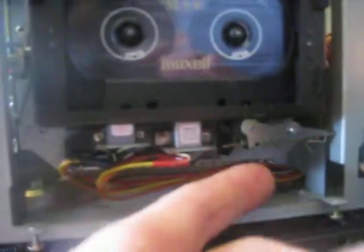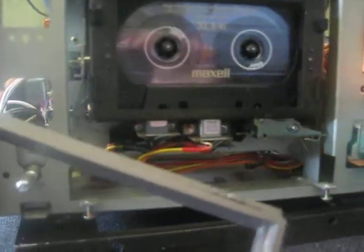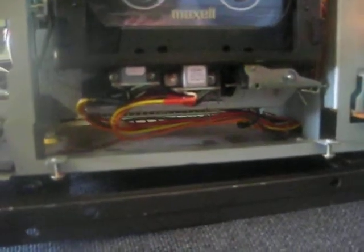I don't know why it stopped now — I'm just having a tough time. There's play right there. So if I press stop now, the heads and the pinch roller are up far enough, but if I press stop, they don't disengage and the pinch roller keeps turning the tape and it just keeps coming out. So I have to basically power it off, or just move the control belt down and disengage the heads.